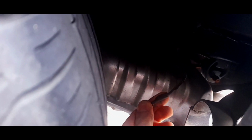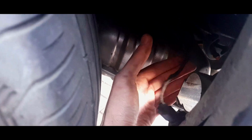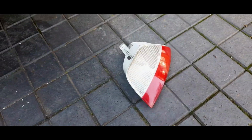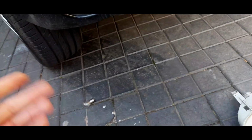But with mine, if you are taking your arch liners away and throwing them in the bin like me, just make sure that this wire is not anywhere near this. This wire, by the way, goes in through a grommet inside there. There's a grommet that leads through from the side of the boot by the vents. But that is really all there is to it, and just do the same on both sides, and you will 99% of the time have functioning fog and reverse light bulbs after you've done it like this.